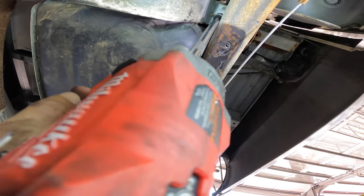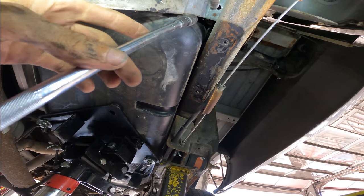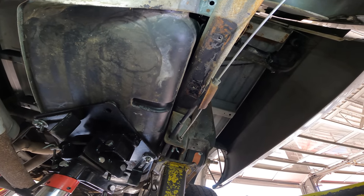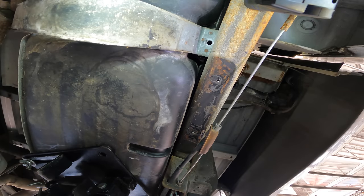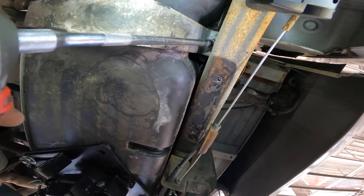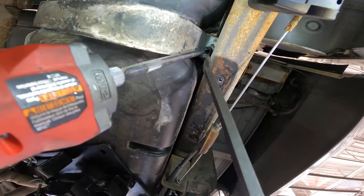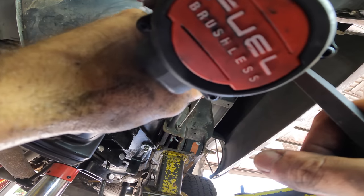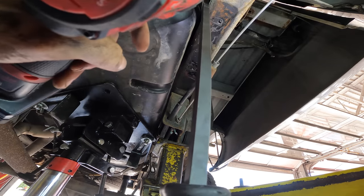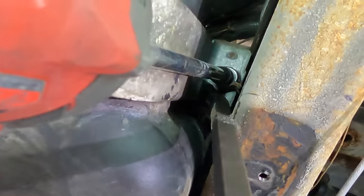These always suck. Need a pry bar. Oh, hit you guys in the face with my bolt there. Not good. I'll show you what I mean when I said I need a pry bar. Watch this. We need to bend the strap to the left a little bit farther to get the bolt to line up. And the pry bar is the perfect tool to reach up there and do that for us. You can't see because my gun's in the way.